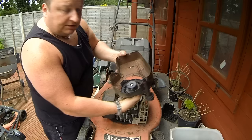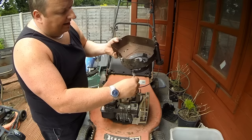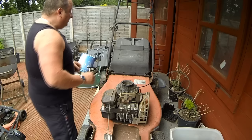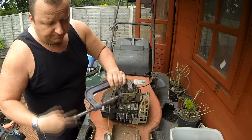This is our recoil mechanism. There's a big spring in there and all we've got to do is basically unwind it - you feed the cord through a hole in the rotating part and tie a knot in it. You need a clamp for that. I can't find my quick-release clamps at the moment so I'm going to have to use a standard G clamp, which is a bit of a nuisance but it will do the job.